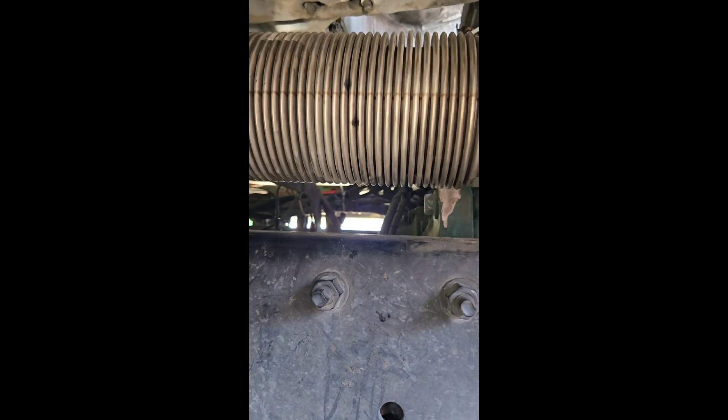If you guys have problems with your DOC and DPF getting a face plug, I have this real fine material — it almost reminds you of fiberglass but a little finer. What's going on is that tube, due to the heat coming from whenever you start burning up here — with several hundred degrees in there over time — it'll start coming apart. Even if you take that tube off and look in there, you can't tell. The way it burns, it comes off in layers and it looks good. But that is the problem when you face plug it. Put a new one on it and it'll take care of your problem.